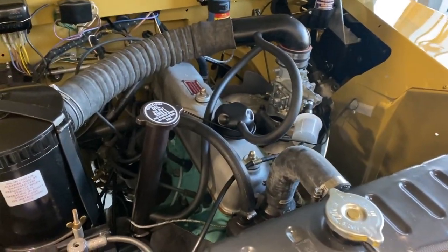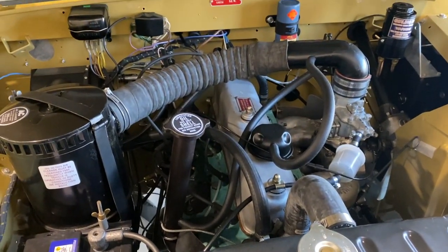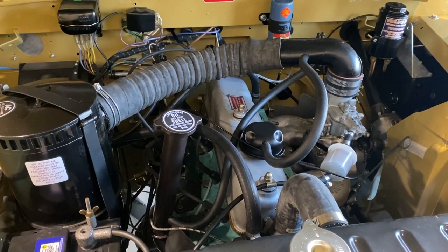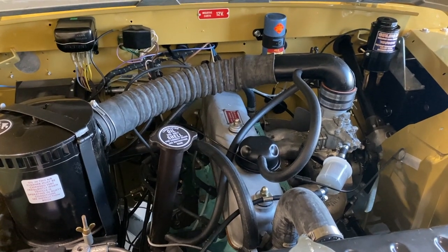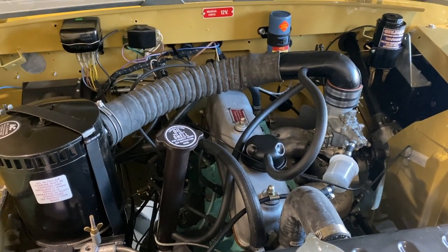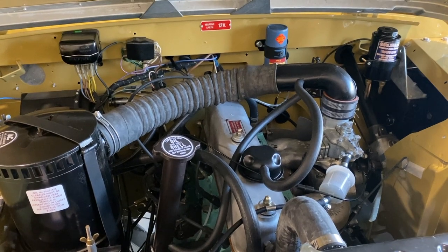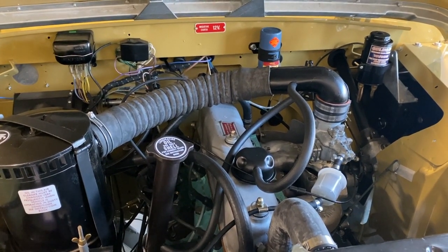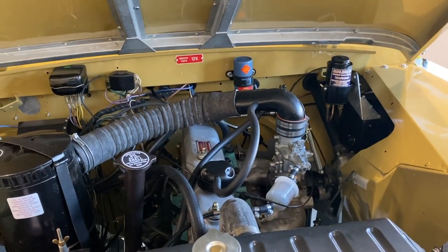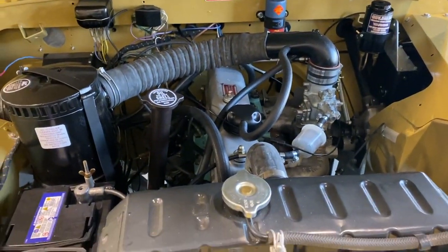All right, so what we're looking at is a 2.25 liter petrol engine connected to a 4-speed gearbox with synchromesh only on the third and fourth gears. So this means shifting into second is a little precarious and requires some practice, double clutch downshifting, and really, practically speaking, is probably best avoided because the engine does have a lot of lugging power. So you just hit third gear and lug it rather than attempt a 3-2 downshift.